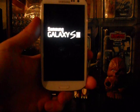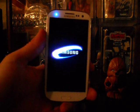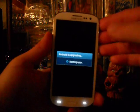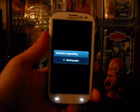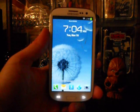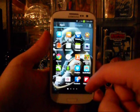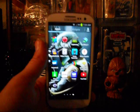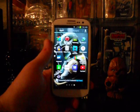If you're following the instructions on the computer it'll be a little different. Once the phone reboots — the biggest thing is, if you followed all these steps you should have root. Always check your applications to make sure you have SuperUser. If you do not have SuperUser, something went wrong. Your phone will look the same exact way and you won't lose anything. SuperUser — if you do not see it, your phone is not rooted.